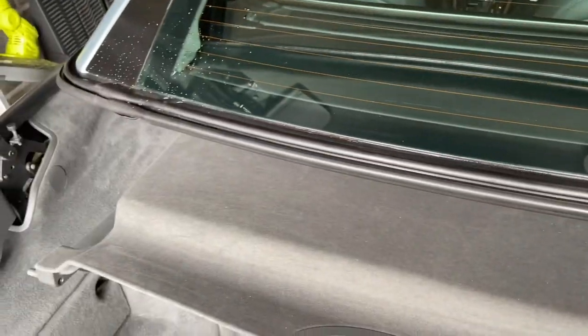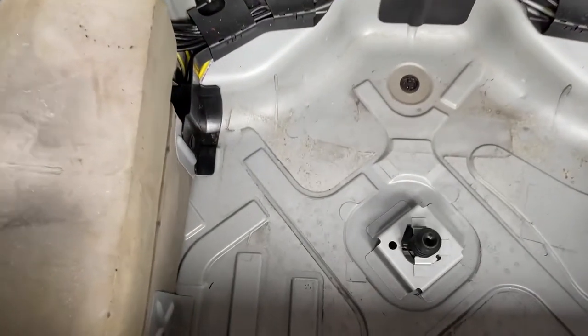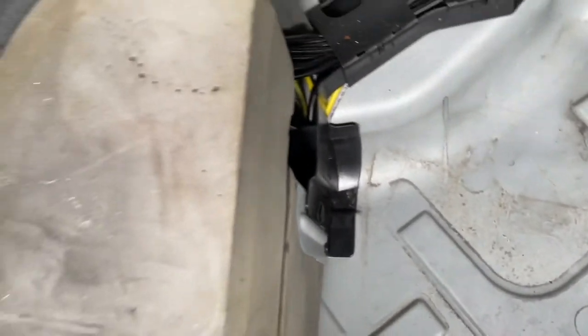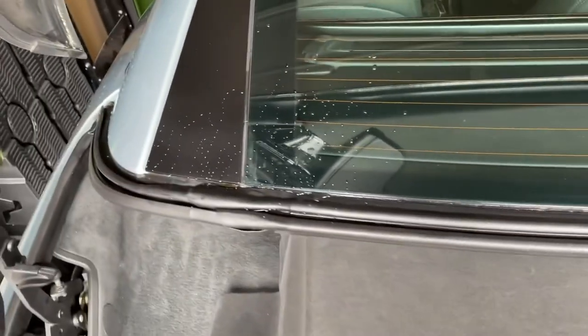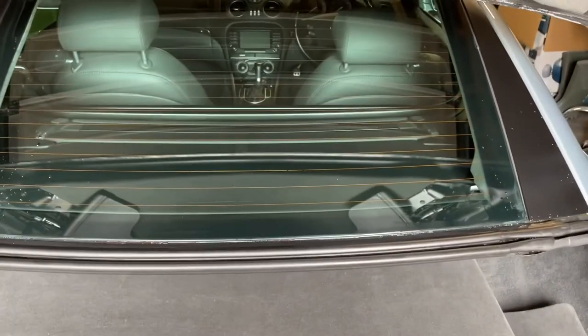I'm pretty happy about that because it was obvious the water was coming in. I've checked the trunk — it's all bone dry. There was a little bit of dampness underneath the sponge, I think just because water had dripped down and the sponge soaked it up, but we'll keep an eye on that. That's your hydraulic pump for the roof, and below it is the pump that controls the central lock, boot lid, and soft close — two pumps under the foam pads. The seal looks great — you can see the RTV just squeezing through. So if anyone has a leak dripping onto these sections, give this a shot. I hope that helps — thank you very much, I'll see you in the next video.